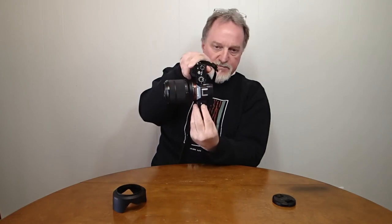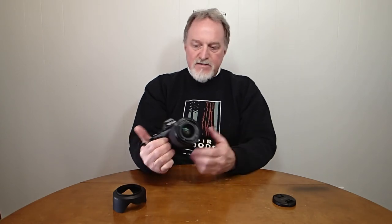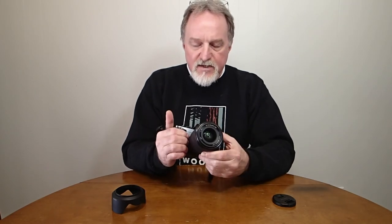The other reason: because there's no mirror — it has an electronic viewfinder — it doesn't have to reflect up into a pentaprism, so the flange focal distance is really short. That's the distance from where your lens meets the body to the focal plane. The Sony's flange focal distance is 18 millimeters — that's super, super short. Canon EF and EF-S lenses are 44 millimeters. So I can use a lot more old lenses on this camera. I have some beautiful FD glass, but its flange focal distance is two millimeters shorter than an EF lens, so those lenses would actually have to sit inside a modern Canon. This camera is a lot more flexible for using old lenses.